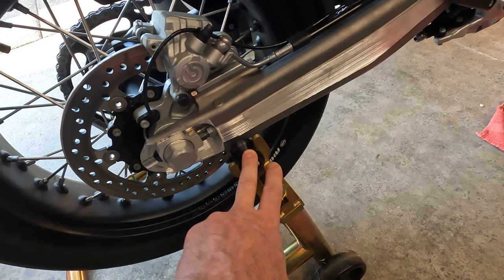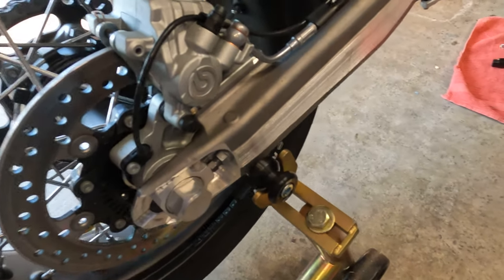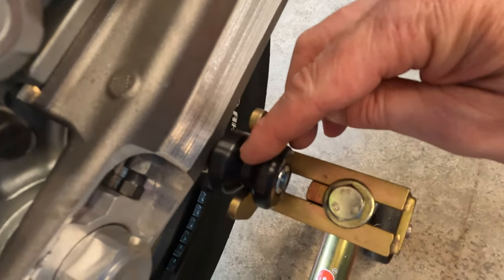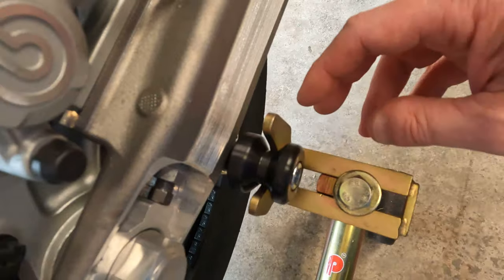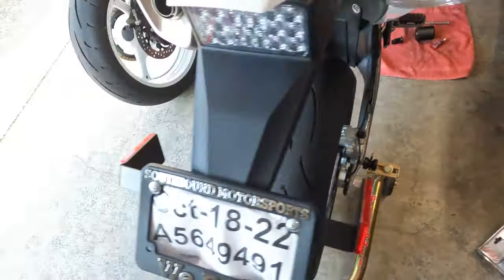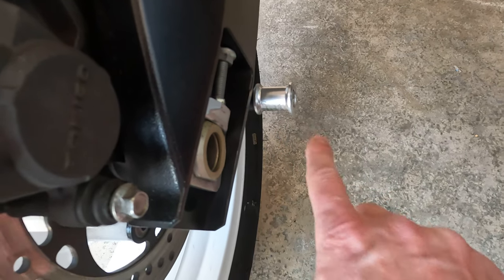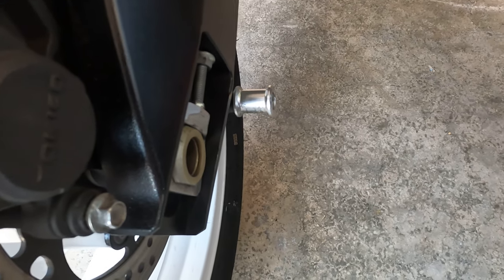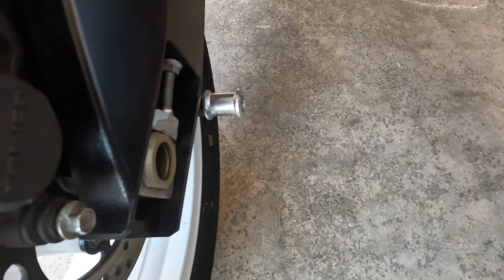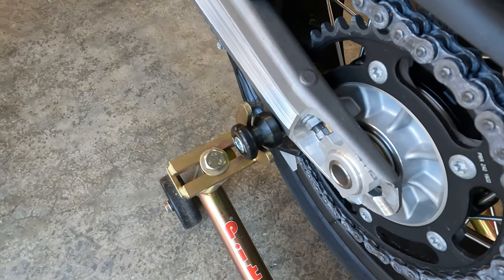So these standard ones where you put them on a standard motorcycle position - this is definitely a better option. One thing to note: the throw on them is really, really tiny, which is the actual travel distance where they mount. So your stand has got to be pretty much spot-on. As opposed to this other one over here, where you can see there's a good amount of throw, so your stand doesn't have to be spot-on to get good contact, and it's got a raised lip on either side to catch. These ones, you've got to be right on the money.